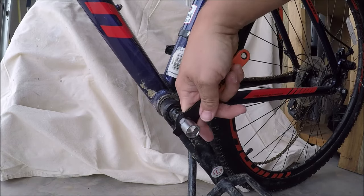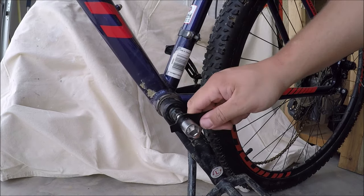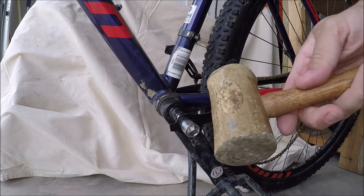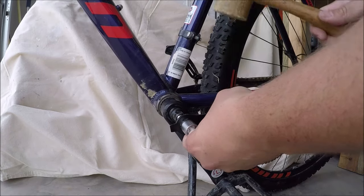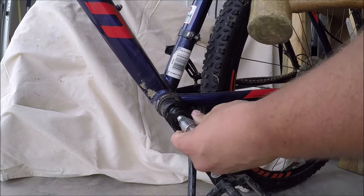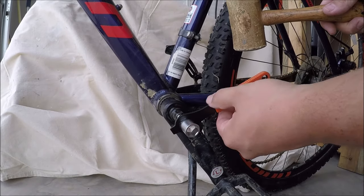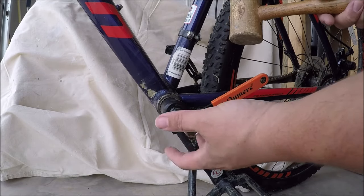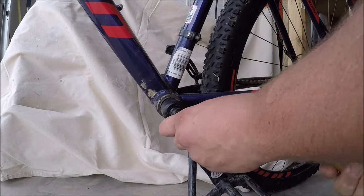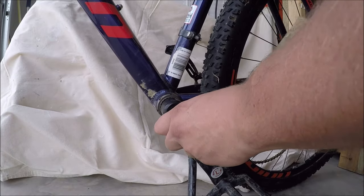This is a little bit tough at this point — I'm going to go a little increment at a time. Sometimes it's going to get hung up because there's a lot of friction on there. What I do is grab my rubber mallet — or in this case a leather mallet — and just tap it. I'm not tapping too hard. As you can see the handle is still in pretty good condition, and I've done this about four or five times. You feel like it's hard at first and then it gets easier as that crank arm comes off.